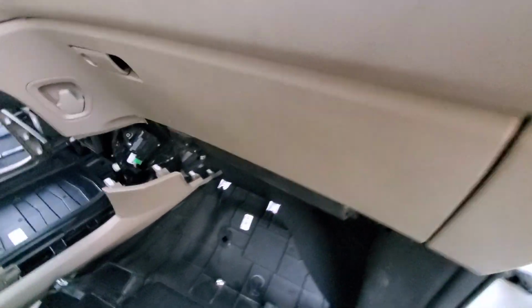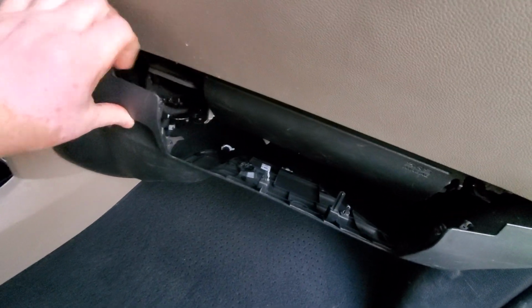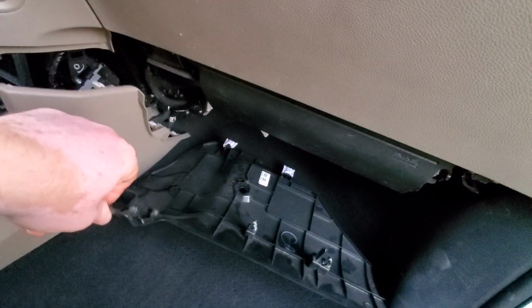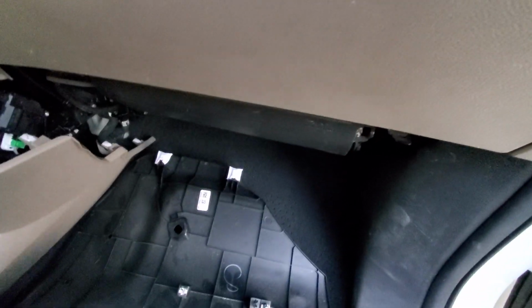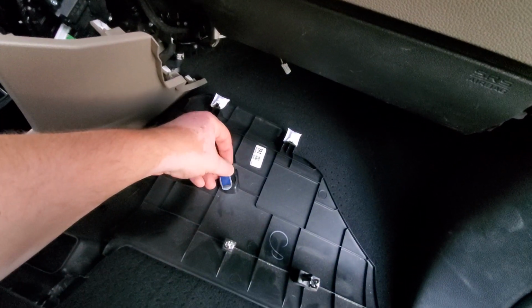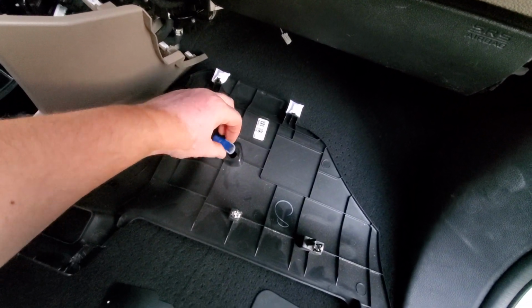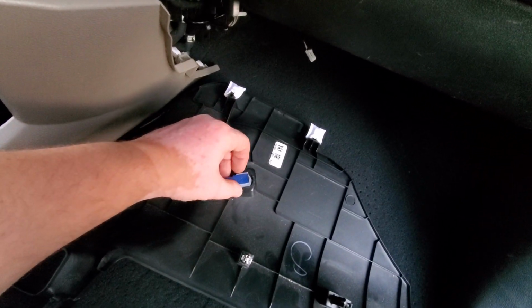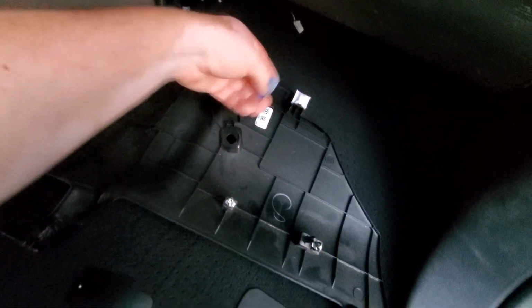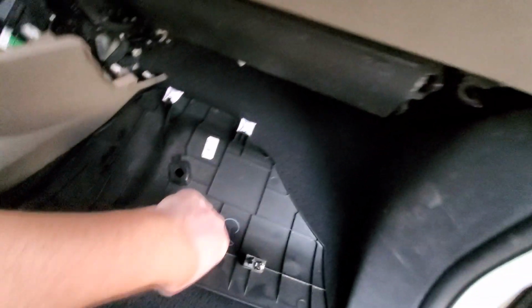you will need to take down this cover, and it just comes down. There are no screws that hold it, so just pull this out of the way. And the little light, let's see, mine has a light, not all have lights, like that. It just turns. You can pull it out, or you can disconnect it, leave it inside. I'm gonna wash this part, so I'm pulling the light out. Gonna leave the bulb in here.